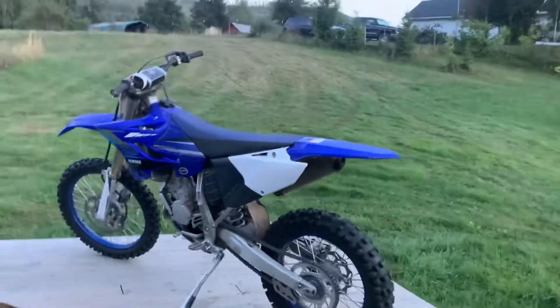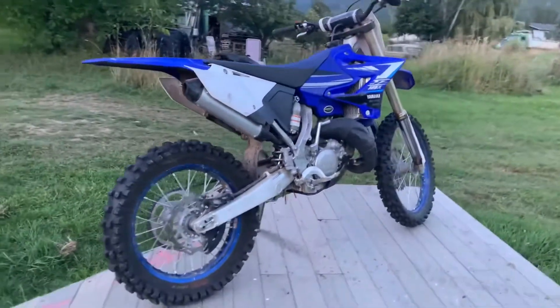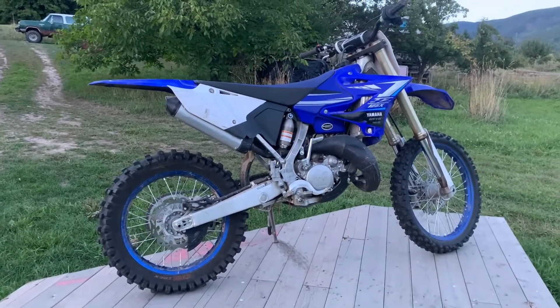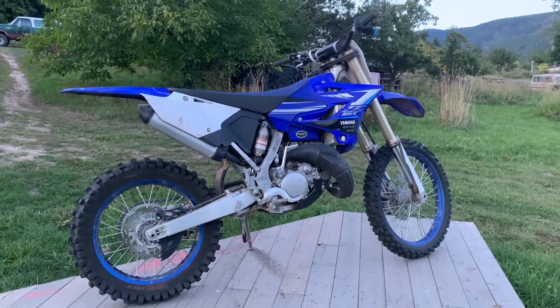So far that's the stuff I really like. If I was going to spend a fair bit of money, I might go to a different carburetor, just because I find this one I'm having trouble getting the float set just right into the really steep stuff — it seems to always be leaking gas out of the carb.